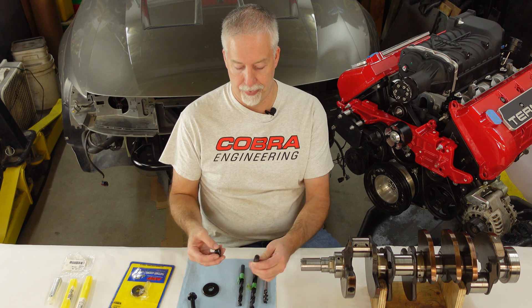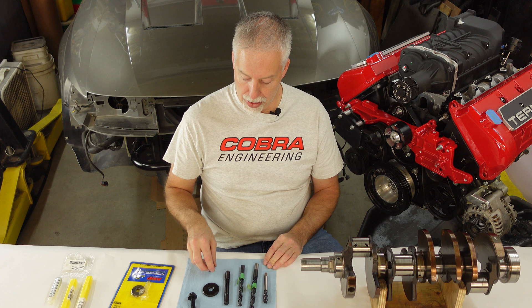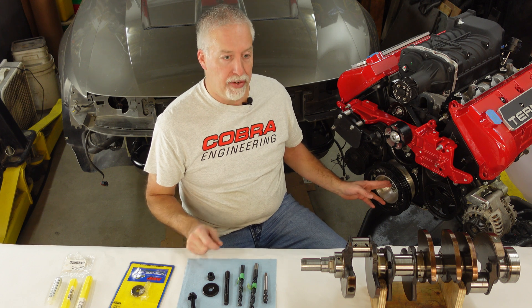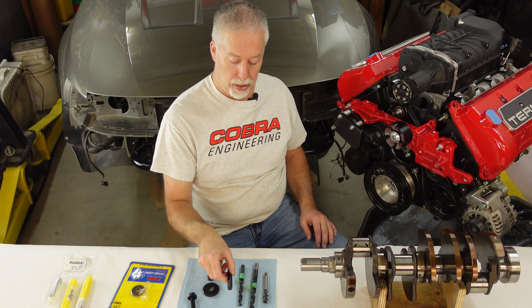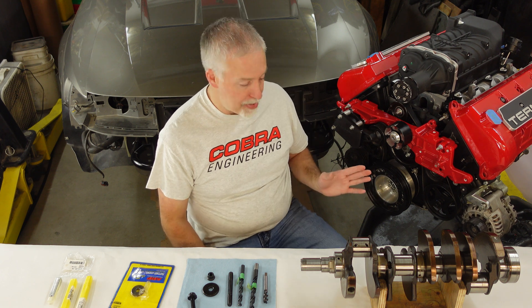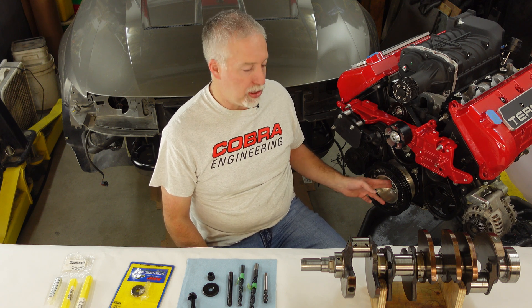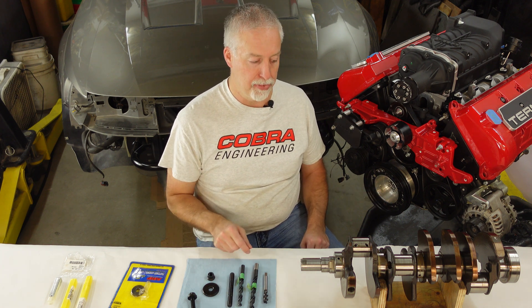You can see the nut. A little thread sealer on there — that goes all the way in. This one isn't drilled. And we torque that down. You can see here it's all set up. Now this one with the Innovators West balancer I had to use a 5-and-a-quarter-inch stud, where this is a 4-and-3-quarter which would be more normal. I believe the hub on the balancer is a little longer, but I'll put both part numbers up — just a half-inch difference, not that big a deal. A little bit sticking out here, but because we don't have the stock lower pulley we don't have to worry about any interference in the middle. With the stock lower pulley you're going to have to worry about that — you want the shorter stud.